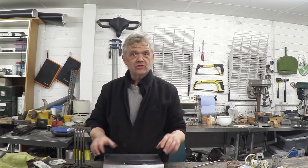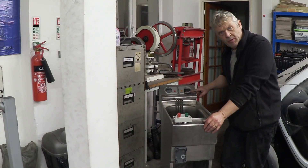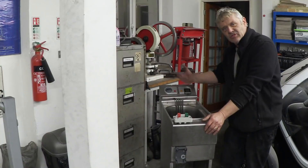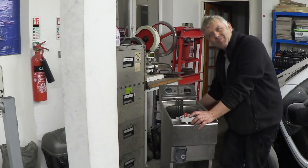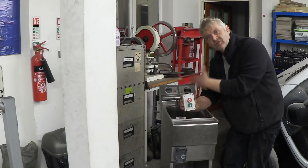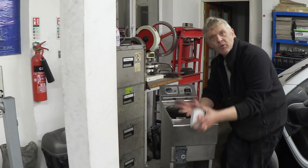Now what I'm going to do is reassemble all of this, get the electronics in place, a little bit of painting, a little bit of hole cutting. I've cleaned everything and tried to preserve what I can - where I put the PID controller I've taken the old control out and made it part of the decoration to keep it looking balanced. The original emergency switch was at the back, which seemed weird - if you've got an emergency and you're trying to lean to the back to get it, that doesn't seem sensible. So I bought an IP rated enclosure for it, because obviously it's a fat fryer, and now the on-off switch and the kill switch are going to be at the front.